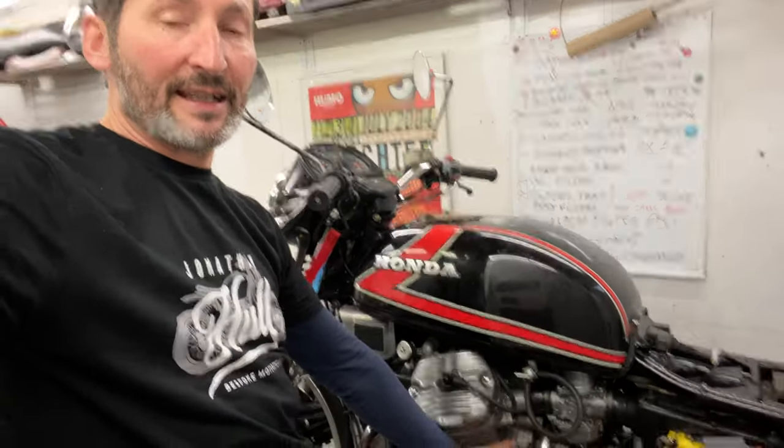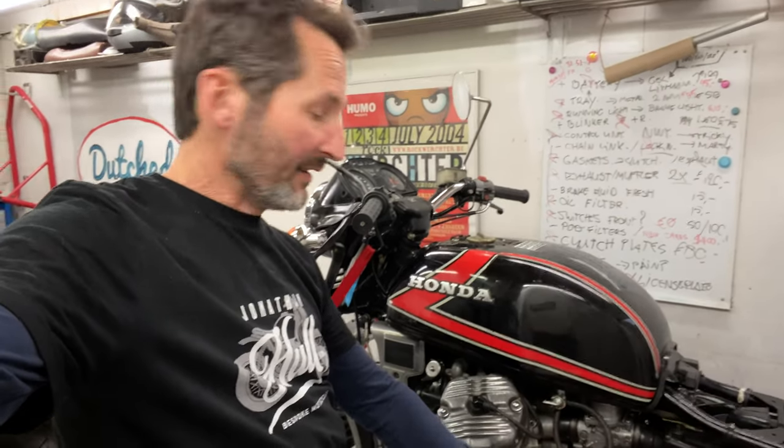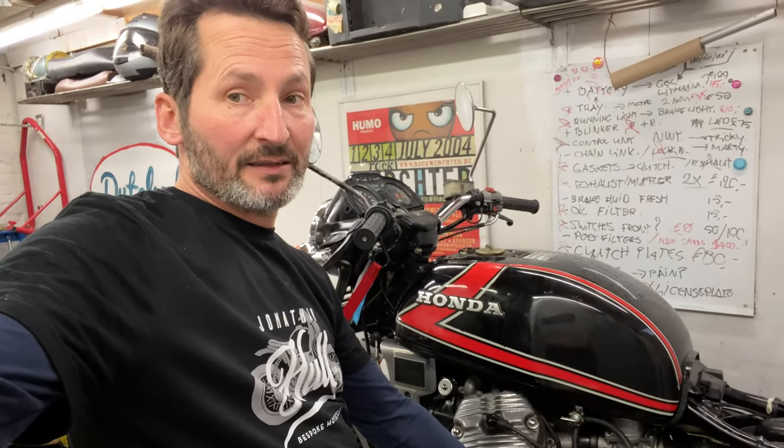So I hope you enjoyed that. A lot of tank cleaning video this was, but it was a really important part of this daily rider upgrade, or for any tank for that matter, and motorcycle. The tank has to be as clean as you can, because all the crap may come into your carbs, cause issues, and the carb is going to be the next video, I think, the work I did on that.